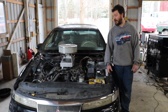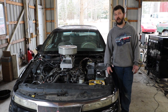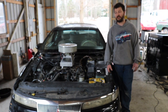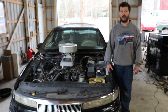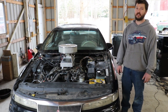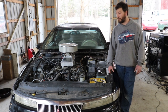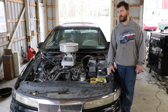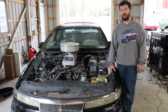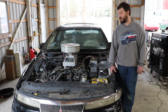Then we had issues with the vacuum signal of the carburetor being able to draw enough fuel out of the bowl, because I don't have adjustable air bleeds in this carburetor. It's just a random carb I bought from a guy at work. I took it apart, checked it out, set it all back to factory settings, put it back together, and ran it — it was ridiculously lean. We kept going up in jets and I think we ended at 84/90, which is way too big for a 281 cubic inch engine, and it's still lean. So there are some inherent issues with this design.